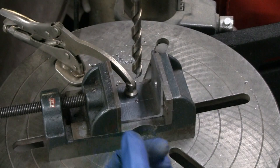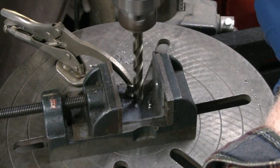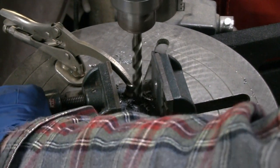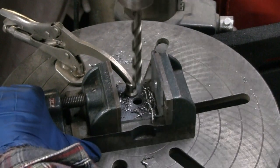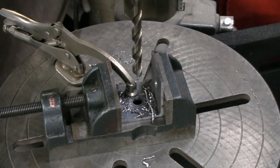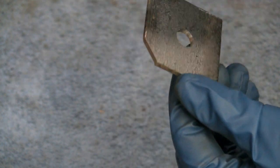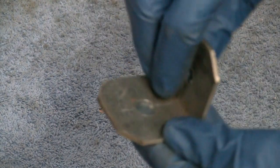Watch out for my arm — I've got to turn it on. See that drill's never been sharpened — that nice curl that keeps coming out of both sides. The rest of you guys can oil everything you want, but I prefer not to. I cut the corners off of this piece here — looks pretty rough now, but that's just so I don't have to take off so much on the sander. I have to change the disc on my sander, so this will just make it a lot easier. What I'm going to do is round off these little corners and then give it a nice spin and get the whole thing round.